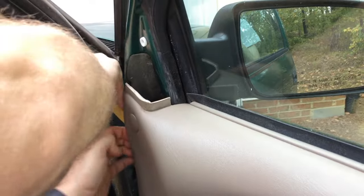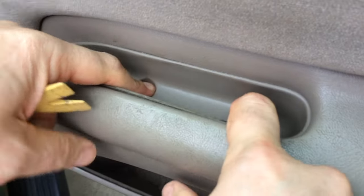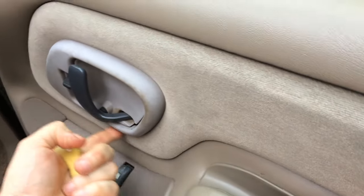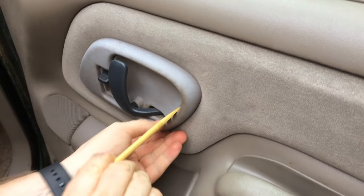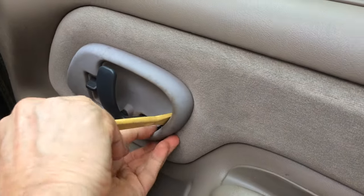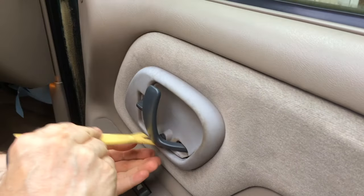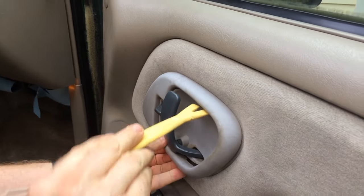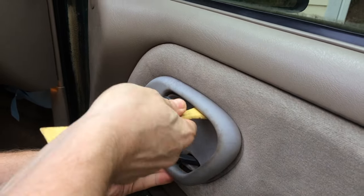We'll set this aside - he just pops inside there and we'll put him back in. There are a couple of Phillips screws inside this door handle piece here, and then we're going to need to take this piece off. You're going to want to be a little bit more careful with this piece because it's probably old and really brittle, at least on this truck, because I've had it off before. What you've got is a retainer on the inside and then a retainer on the other side. Let me get this guy to loosen up before I pop him.